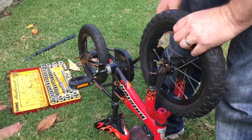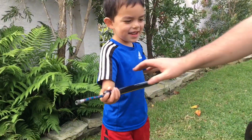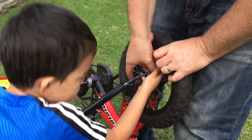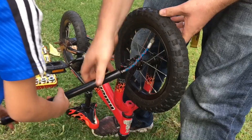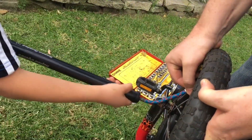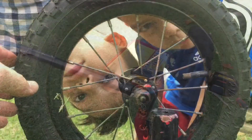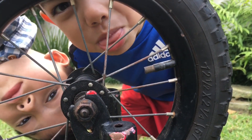It takes all the pressure off the inner tube and allows us to bring our valve stem all the way through — like that. Now we can pump our tire back up. Joel, any guess what we might use to pump the tire up? A pumper to pump up the tire. So we screw this on to the valve — like that. I'll hold this so the valve's in the right place and you can pump it. We have a nice straight valve stem that sticks all the way out — no longer getting pinched.